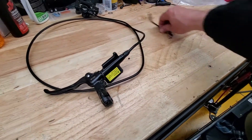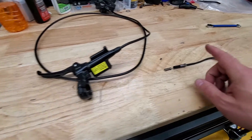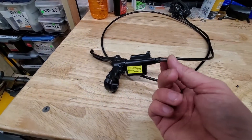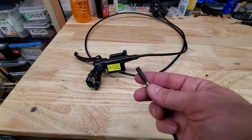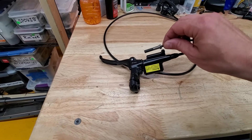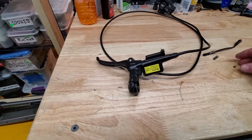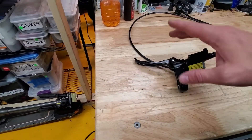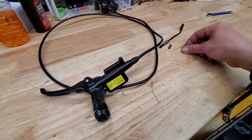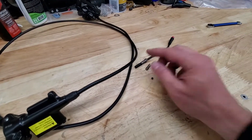So I offered him hydraulic disc brakes with a brake sensor. Inside here we have this spring, then the sensor itself, and this bolt. You screw the bolt in and the spring keeps the sensor from moving back and forward. Once you fix it, you try pressing the lever to see how the bike reacts, and once you adjust it, you put this tiny screw to lock the bolt.